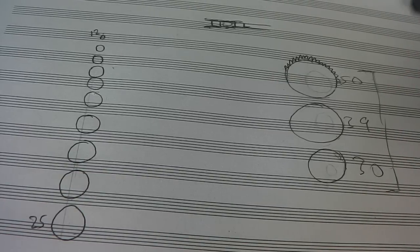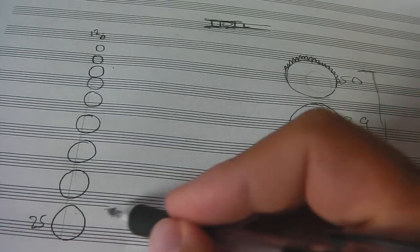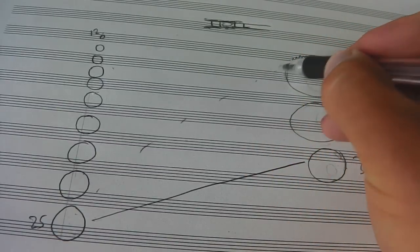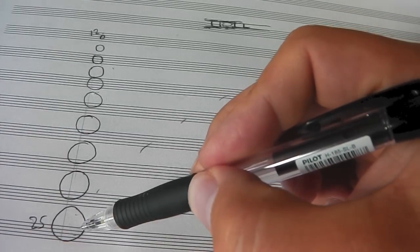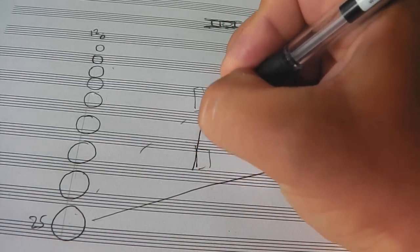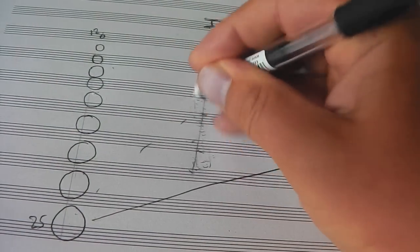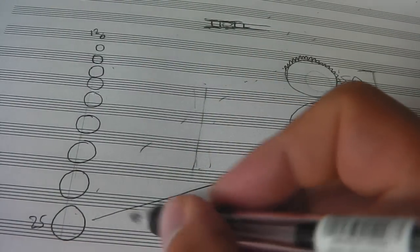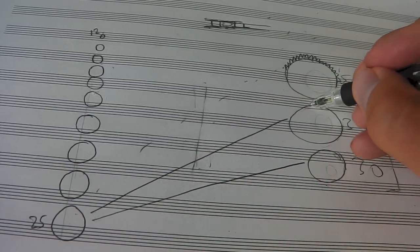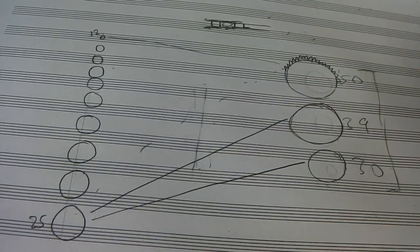Just to explain what I'm doing here, if you have your gears on, let's say we're on the bottommost gear, which is this one here, the biggest of the back with the smallest of the front. You'd never put the biggest of the front with the biggest of the back, because then the chain would look a bit like this. You'd have the gears there, and it would go like that, and the chain is not designed to do that, so it would probably snap. So we can't do that, but we can have this line here between these two, the biggest of the back and the smallest of the front, and the biggest of the back and the medium cog here. And the same goes for here. We can have the smallest with the biggest, and the smallest with the medium.